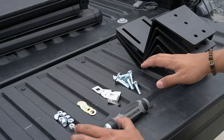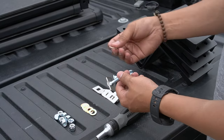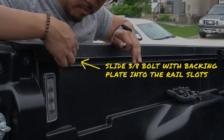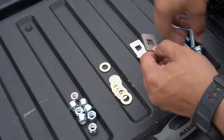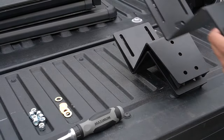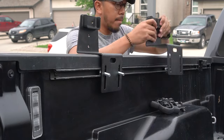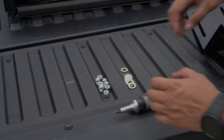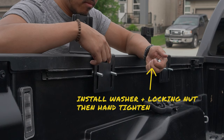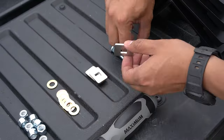After doing this for both sides of the truck, let's now prep the mounting bolts. Insert all 3/8 bolts on the backing plates, then use the flat washer and locking nuts to secure this. Grab a set and slide it into the truck's rail system — you're going to need 4 on each side. Then grab the brackets and place them through the bolts. When that's complete, grab the washers and the locking nut — you'll also need 4 sets per side. Install the washer and locking nut and hand tighten. Please note that we'll fully tighten these later once we have the final placement for our brackets.